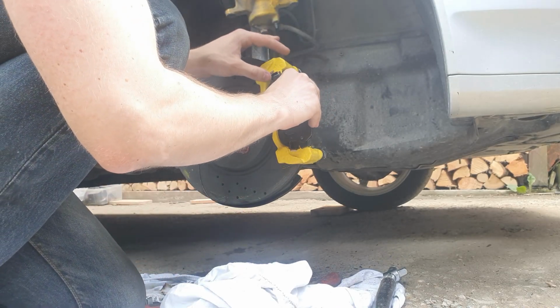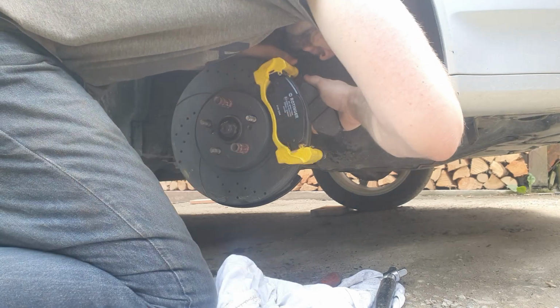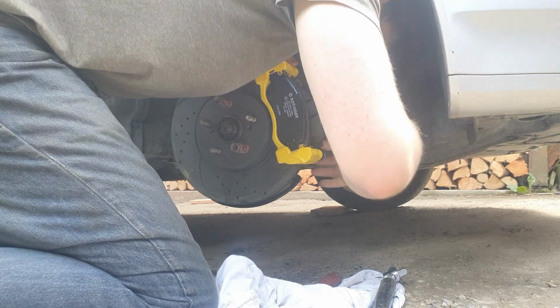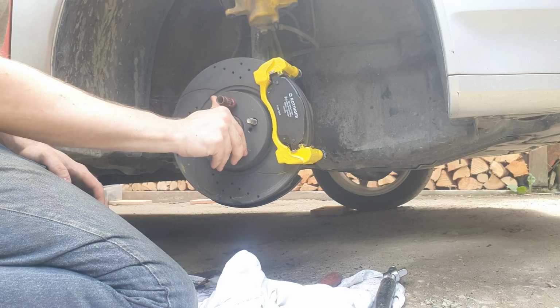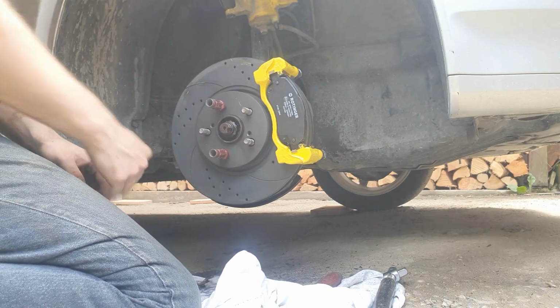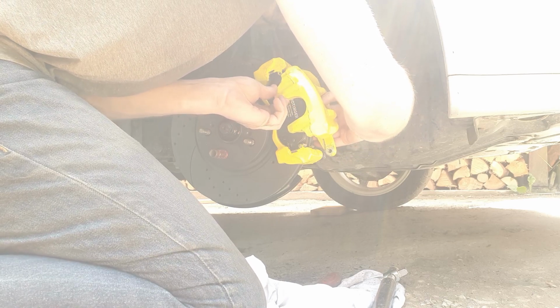Now it is turn for the brake pads, which need to slide into the little plates on the brackets, which will hold the pads by spring force. And now, if you can see through all the sunshine, we can put the caliper itself into place. The Avensis caliper screws into the slider pins with two 12mm bolts in my case.